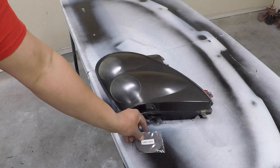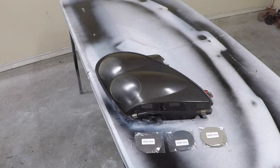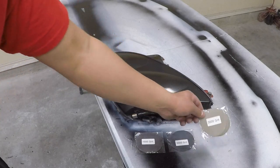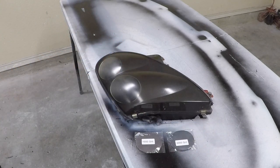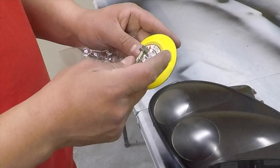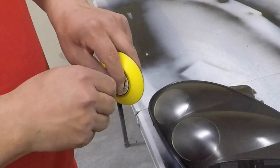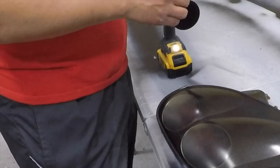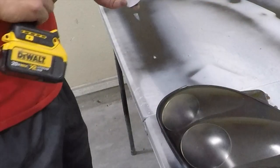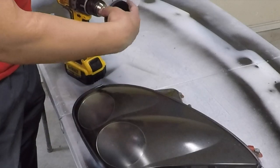We are going to be using 1000, 2000, and 3000 grit sandpaper. These come included in one of those headlight restoration kits you can buy for about 20 bucks. I bought sanding discs on Amazon to test them out but I didn't like them — they didn't yield as good results as quality sandpaper. The drill tool attachment usually also comes with the kit; the sandpaper attaches with velcro. You can also do it by hand if you don't have a drill. I also use a foam pad because it contours to the shape of the headlight and helps sand it better.